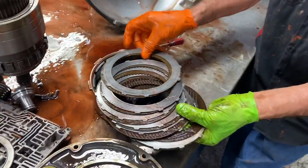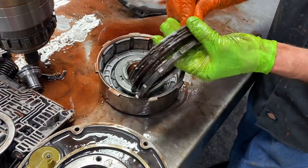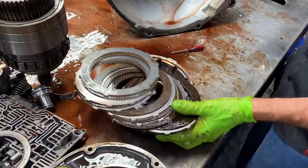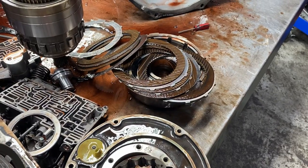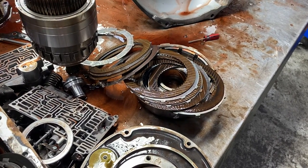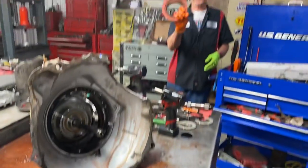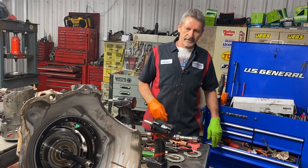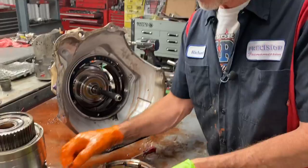We've got our high gear clutch - one, two, three, four, five, six clutch. We're going to go with some Alto clutches in here. I've got all the overdrive parts and we've got it all set over here - all the stuff to put in this thing that's going to make this unit a proper transmission. Mainly just get the clearances set right and everything about it. We do have a 48RE drum - the snap ring groove is up high. The lower the groove, the less clutches are going to fit in there.